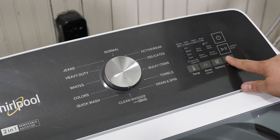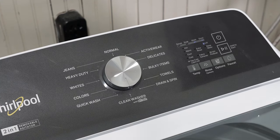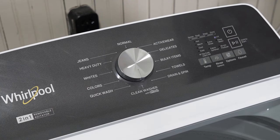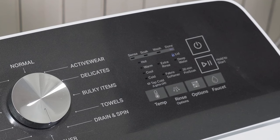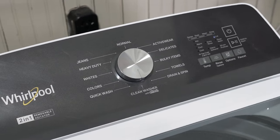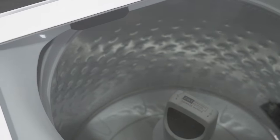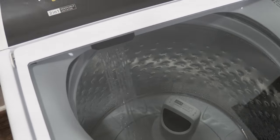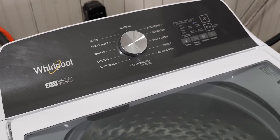If you are entering this code correctly, the lights are going to start turning off as you press the buttons in order. At this point you may hear the washing machine make some noises, and then the whole LED panel is going to blink a few times. The lid lock will flash and unlock, but this whole process took about ten seconds, so be patient. The last step, once the door has unlocked, is to open the lid and then close it. Almost as soon as you close the washer lid, it should re-lock the lid one final time and the lights will start running and blinking in order. The reset is now starting and will run for quite some time — the shifter will run, the water will start, and the entire calibration sequence will begin. This entire process takes about four minutes. Once complete, the lights will flash off and you are totally done with recalibration.